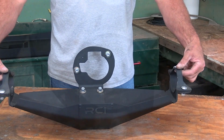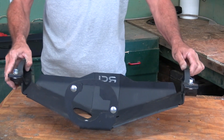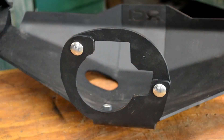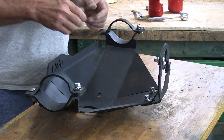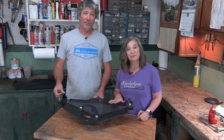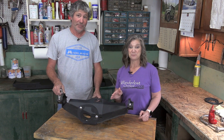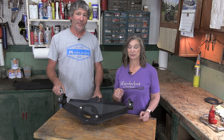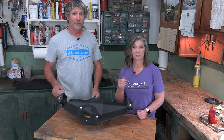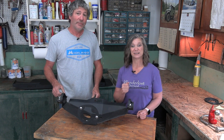It's really easy to install. These straps go up over the axle tubes and this bracket goes up and over the front of the diff by the u-joint. The whole assembly mounts up nice and tight to the diff so there's minimal loss of ground clearance. This one is for non-KDSS. RCI makes one for KDSS that's slightly different but looks like it installs in the same manner. Also their diff skids for Tacomas and FJ Cruisers are very similar and install in basically the same way.